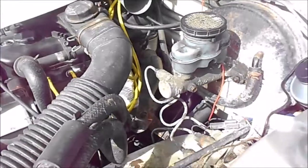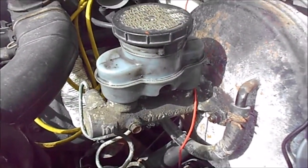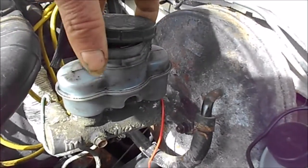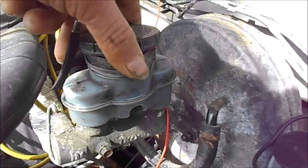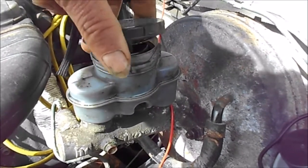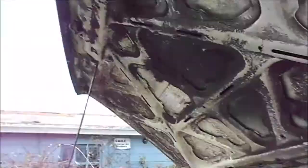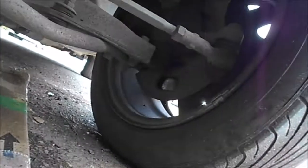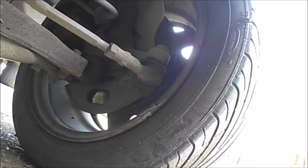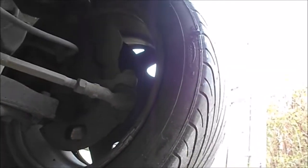Now I've got a problem with my brakes. The other day I checked and the brakes were low on fluid — normally it doesn't use fluid, but it was dangerously low. I could feel my pedal was kind of soft. I looked at all my wheel cylinders from underneath the car and I didn't see any leaks.